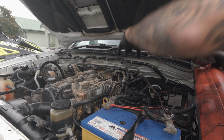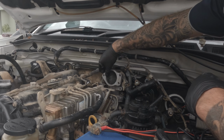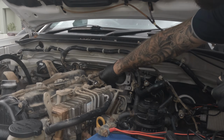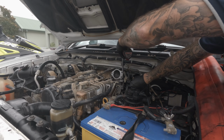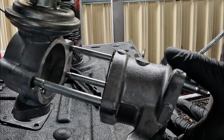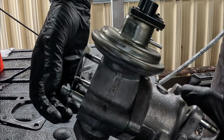Firstly, don't forget the gasket, then the 90-degree pipe. Fit the 3 bolts and loosely tighten. Some movement is needed for the next part. Now with the remaining parts, fit them together like so. Be sure to remember gaskets between each join and on the bottom of the EGR.